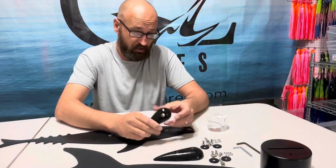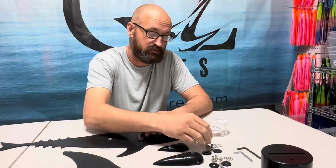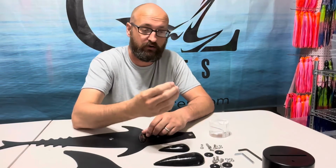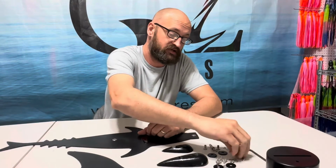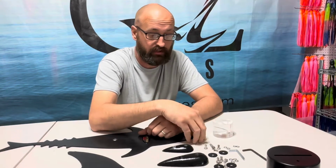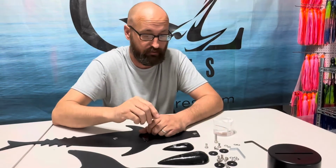Okay, first off, working with the mediums. The mediums are going to use a smaller anode. For the smaller anode, you're going to be using 2 fender washers, 2 binding nuts with a 3mm Allen on the end of it, and then also a 3mm button head with 10mm length on your shaft. You're going to have 2 lock washers and 2 flat washers that go with them. Your kit comes with 2 3mm Allens to tighten down the components. The only tool that is not included is a 13/16 wrench or Allen wrench for you to tighten down your head bolt. And I'll show you how to attach all this.